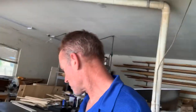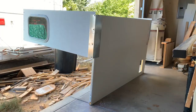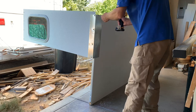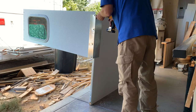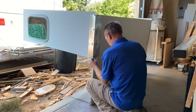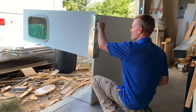Now I just need to flip this thing around on its face and get the screws in from the bottom into the floor. Since that's got aluminum framing, I'm going through the steel flashing and into that aluminum framing with some shorter coated screws — one-and-a-quarter inch. The unit's flipped over; got my four holes drilled and these screws in. These will all be covered with the trim and sealed up with EternaBond.